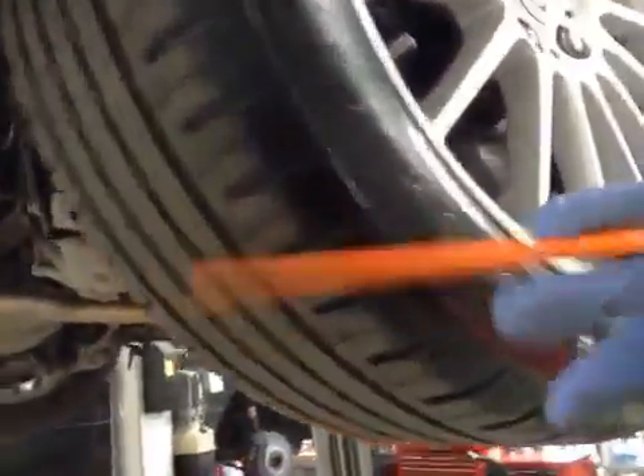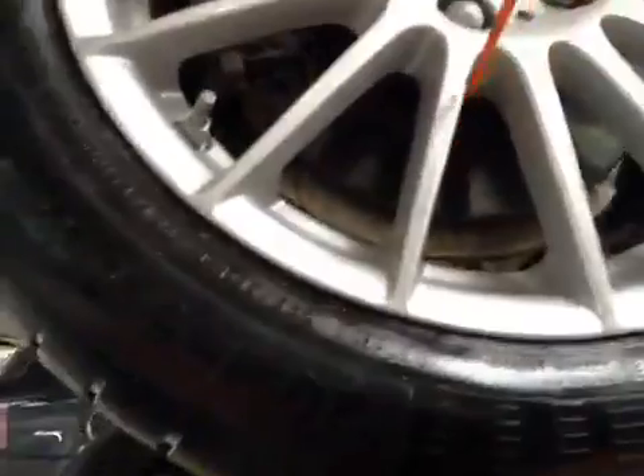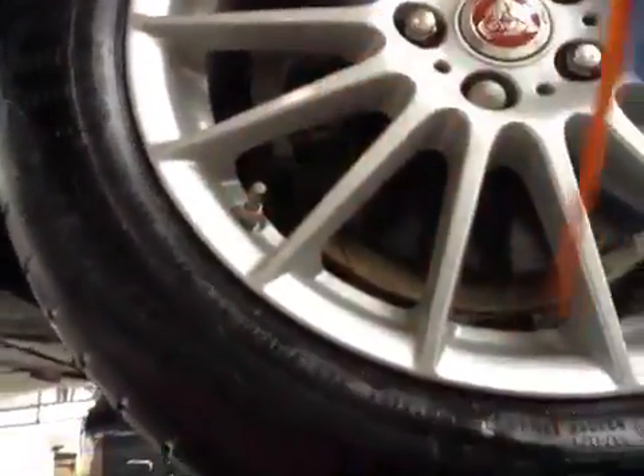All the same as on the driver side — again, all the suspension is OK. The rear tyres are just below 5mm worth of tread depth, tyres are in amber. The rear brakes are in good condition. The rear brake pads are getting roughly about 4mm. The pads are in amber, disc in green. The tyres are in amber on the health check.